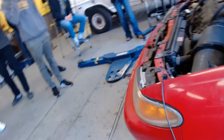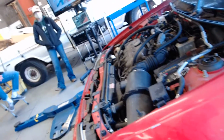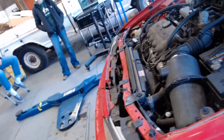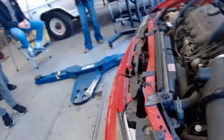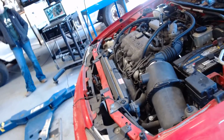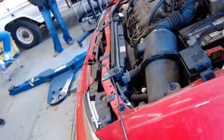So I assume if you've got a quarter tank or less than a quarter tank, I'm going to tell you you've got to add gas, because I've had cars come in where it said there was a quarter tank and it wouldn't start because the gas gauge wasn't accurate. So whenever I see a car that's below a quarter tank, unless the person knows for sure that it runs fine below that, I'm going to say add some gas.